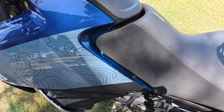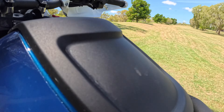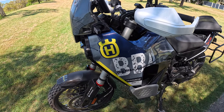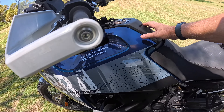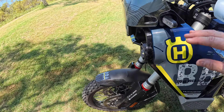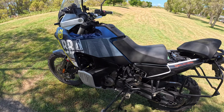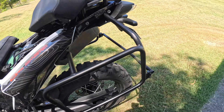In terms of working on this bike, it is just so easy. I had to take the panels off — there are four fasteners holding that on. You take the seat off, take the side covers off, they just pop off. Four bolts holding that on, four bolts holding that on, four bolts holding the other side — the whole thing just comes off and exposes everything. The tank is also accessible right underneath, so it's a really cool bike to work on.